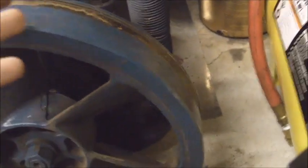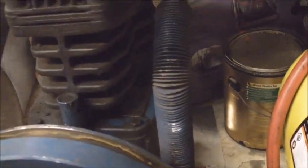I got the intercooler tube disconnected. There's just a bracket right down there — you can just barely see the end of the bracket. That bracket holds it on. Once I take that bracket off I should just be able to lift this up and the intercooler will come right off.